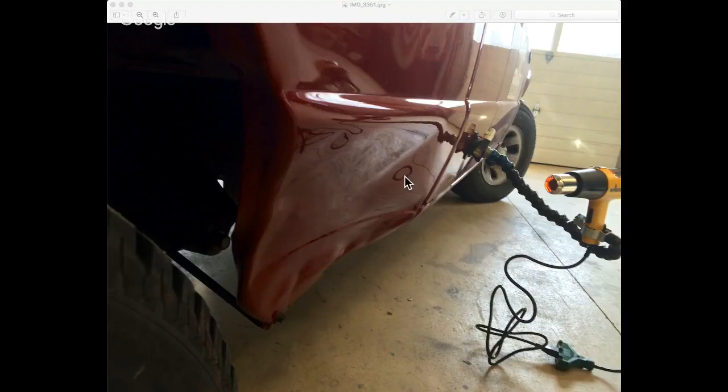See, I don't do much bedside. So my approach would be just try to glue as much as I can, and I would take my Craftsman hammer just to get the majority of that up. I don't care how ugly it looks as long as I'm not cracking paint. And then once I get it somewhat flat, that's when I'll start finessing. I'll probably build a jig somewhere around here so that I can get a tool. Definitely take the tire off. And that would be my process.